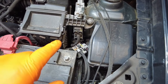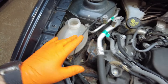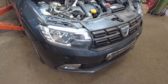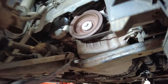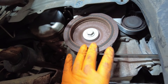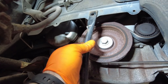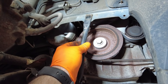First things first, we're going to disconnect the battery negative, take the cap off the header tank, and then take the vehicle up to make a little bit of room. We've got to take the wheel off, the driver side wheel arch, and also the belly pan. With the vehicle up, we've removed the driver side front wheel, the belly pan, and the little splash guard protecting the crank pulley. I also removed a little bar with an 18 and a 13 — you don't have to, but I like to say all the time: the more room the better.